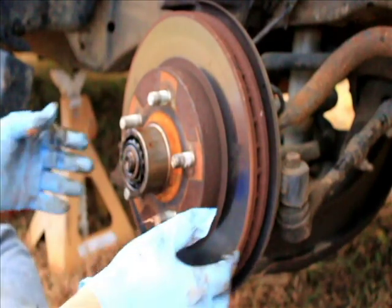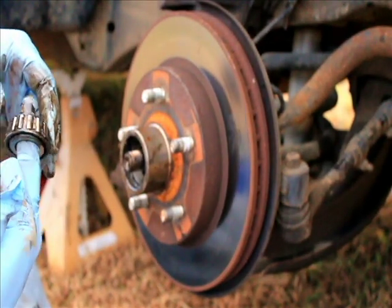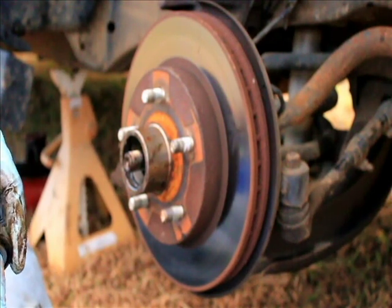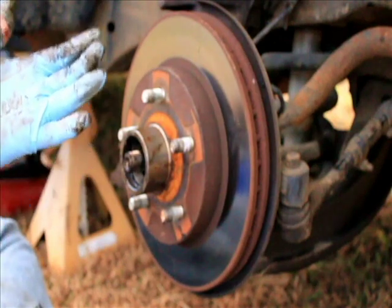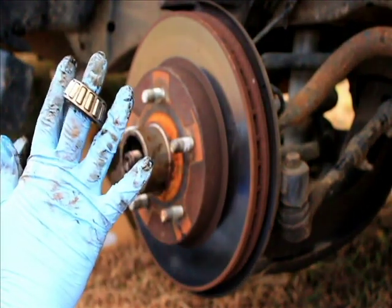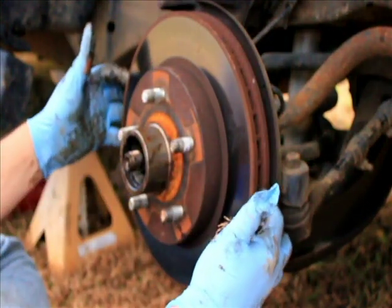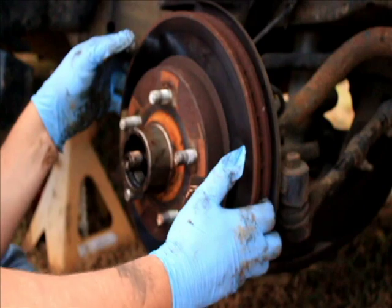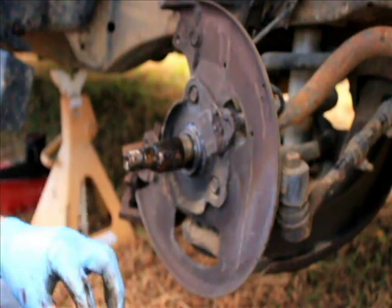You want to be real careful not to get any dirt in them. These actually look a little bit burned, which tells me they've gotten hot a couple of times. Maybe that was just grease on them — it'll burn up grease, but they need some new grease on them anyway. Now you want to be sure not to touch the face of the rotor, because that's where your brakes ride, and if you get grease on them you're not stopping.